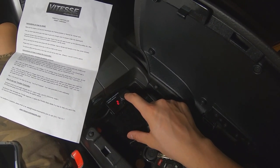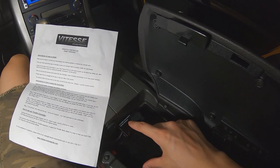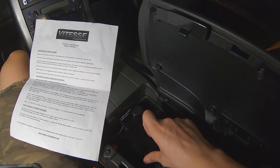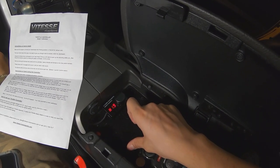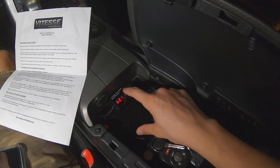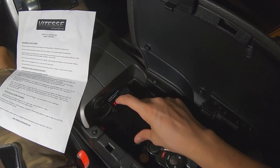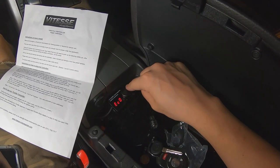You should see a countdown — three, two, one — then let go. This is going to show low voltage, which is the gas pedal at rest. Then click it once to set it, and high voltage will show for the high end. Push the gas pedal all the way to the bottom, and once it's at the max, press it one more time to set it. Now you can release it — half throttle is shown, and all the way down is 100%, which is where you want to be with your foot to the floor.